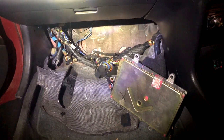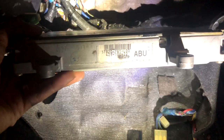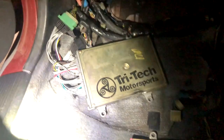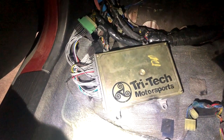Now we're going to be ripping out this OBD-0 ECU — this is a PR4, we're no longer going to be needing this. I'm going to take it out and swap it with my OBD-1 Hondata chip. It's pretty simple — just remove it any which way you can, there should be some bolts holding it on, then take out all those connectors. Once you get it out, you just wire your jumper harness adapter — that's self-explanatory. Then we're going to put in the P61 ECU. This is a B17 computer for a second-gen GSR — it's kind of rare. It's basically a P28 equivalent, so it comes with VTEC but also a knock sensor, which means you kind of get everything in it without having to do any conversions.